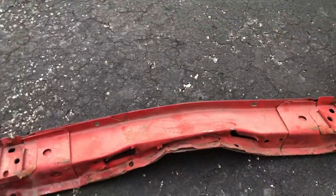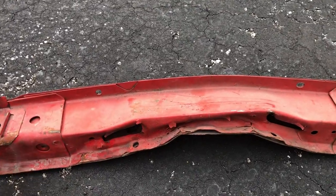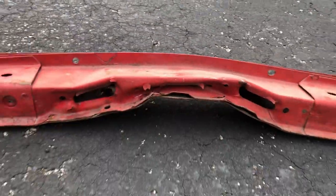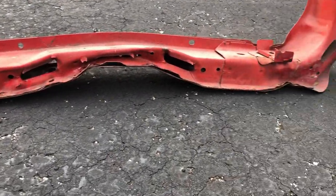With the old core out, you can really see the problem I was trying to address. This is one of the perches where the radiator would sit, and here's the other one — you can really see that hump in the center that was preventing the radiator from sitting in there, causing us to cut it out. On the next video we'll go ahead and address the cooling fan situation to go along with the nice new radiator. We'll put a fan speed controller which we'll design and build so the fan doesn't just run full speed all the time — it only runs as fast as it needs — so this will be another fun project. We'll integrate it with all of this and wrap up and get the cooling system sorted out.